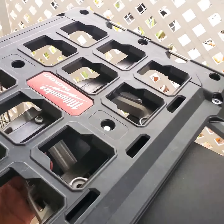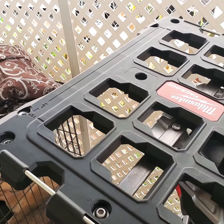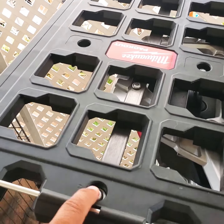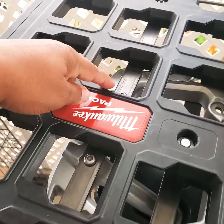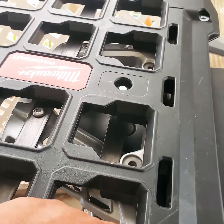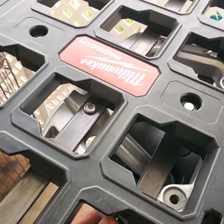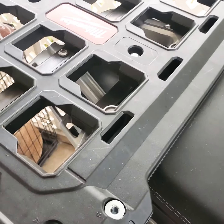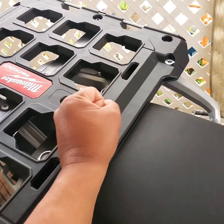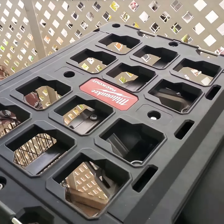I'm glad this bike already has some kind of plate. I removed the plastic they had in there and basically I cut a steel bar and put a bolt here, here, and here. Then I cut another steel bar from here to here and put a bolt here, so it acts as a bracket to make it stable. I may put another bar just to be more secure.